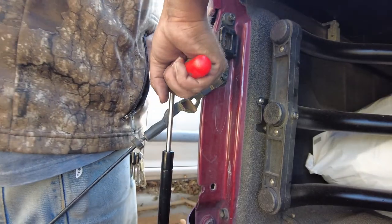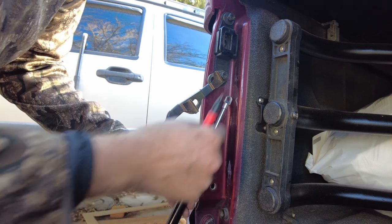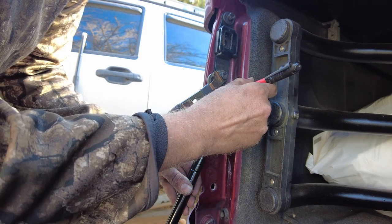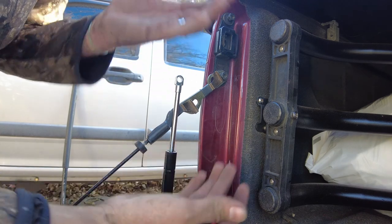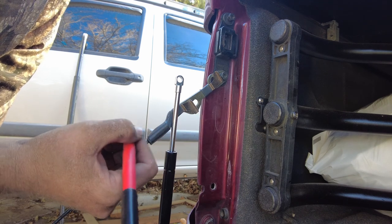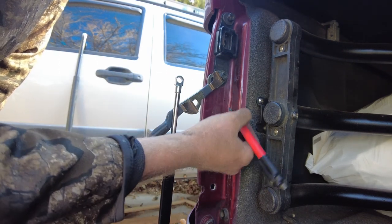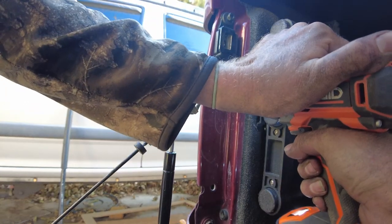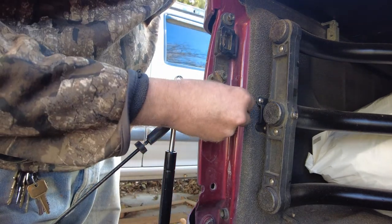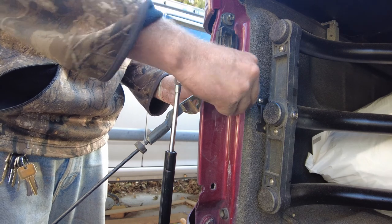Maxed out at about 10 and 3/16 inches, take a Sharpie and put this as far back as it'll go — about a half inch or so from the back — and make a mark at the bottom of this hole. The reason we want to do that is we don't want this shock holding any weight; that's what the cable is for. If you put it right in the center of the hole there's a potential the shock will be holding weight, and we don't want that. So just the tiniest bit under it, and we'll drill a hole for it.